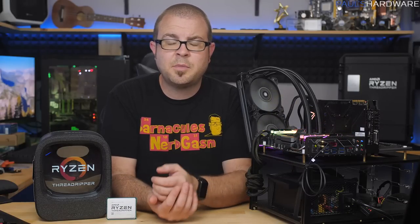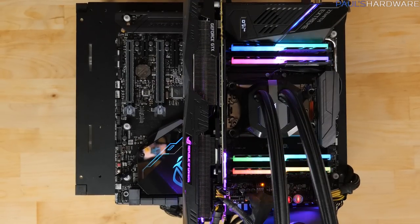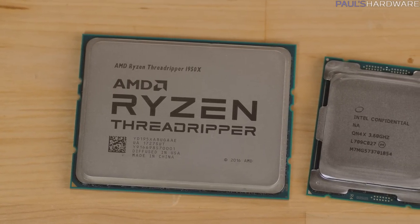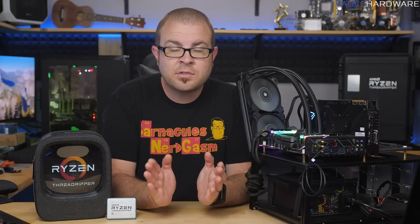Overall, the AMD Ryzen Threadripper 1950X is an absolute beast, especially running software that can use all of its cores — it tears through workstation tasks and I'd definitely recommend it. That said, not all tasks can use all those cores and threads, and in gaming Threadripper still falls behind Intel's best even with Game Mode on. At higher resolutions like 1440p or 4K, gaming performance levels out between these chips, so it's not a deal breaker given Threadripper's intended workstation use. Intel's 7900X runs at higher sustained clocks, leading to higher temps but compensating for having only 10 cores. I'll be revisiting overclocking and will also compare the 12-core 1920X against Intel's 7820X — subscribe if you're interested, and hit the thumbs up if you enjoyed this one.